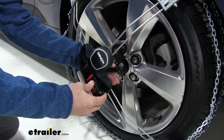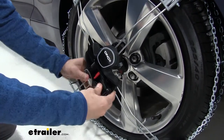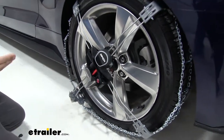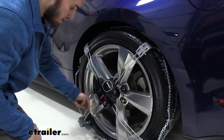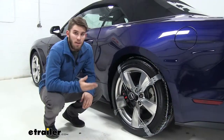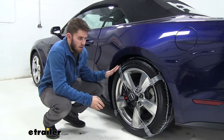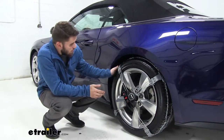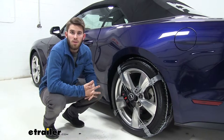Try to go as far as you can with the ratchet. At this point you're already done — you just have to drive forward a bit. It's a good idea to stop, get out, and make sure that your chains did in fact get under the tire and tighten down. We backed up and drove forward a couple of times, and with a little bit of help you might have to nudge them onto your tire. They're going to tighten down and you'll see they're very secure. From there you're ready to hit the road and get through whatever weather you need.